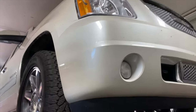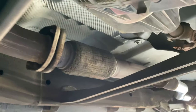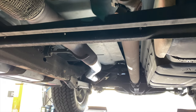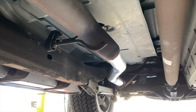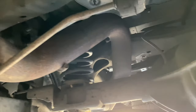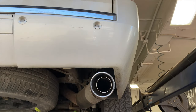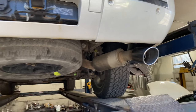6.2 liter beast — what we got done on it: factory converters there and there, then it Y's into a single. He's going to bring it back and we're going to do true duals after he puts a cam in it — into 10-inch tips, believe it or not. So stay tuned. We did a muffler delete on it, three-inch pipe, then a three-and-a-half-inch tailpipe. Still got the factory resonator — he didn't want the rasp, he wanted the sound without the rasp. Into a five-inch roll tip. We'll have a link in the description for that tip.